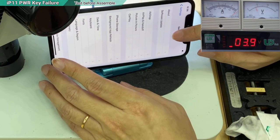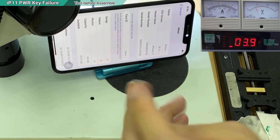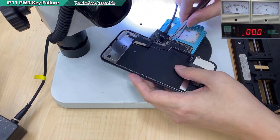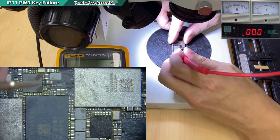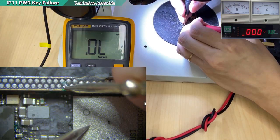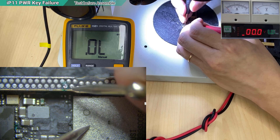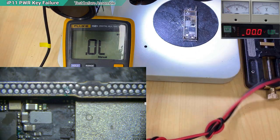Going to Settings > About to check — the NFC is working now. Only Face ID is left to verify. The pin I repaired should now have a value on one side: 449 and 448 on the repaired pin, and OL on the power button pin. They are no longer connected to each other. Let's reboot to confirm full functionality.